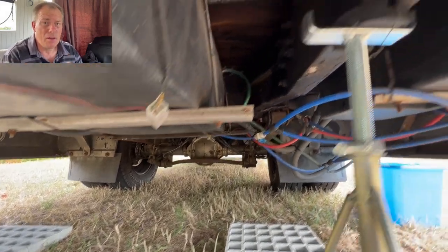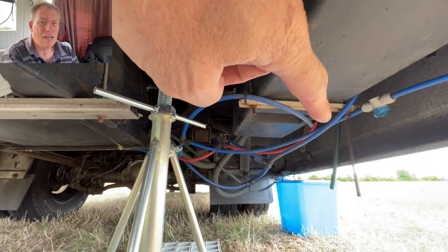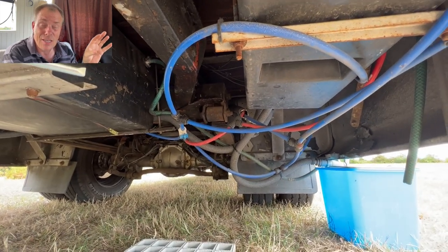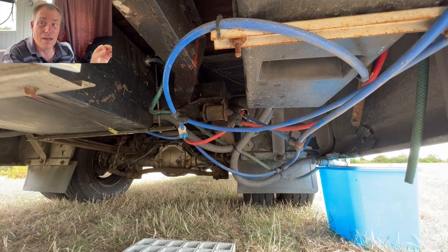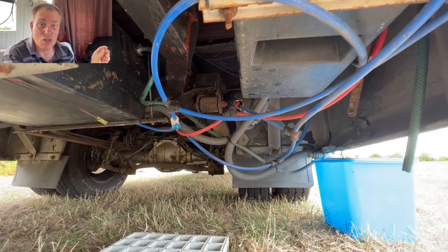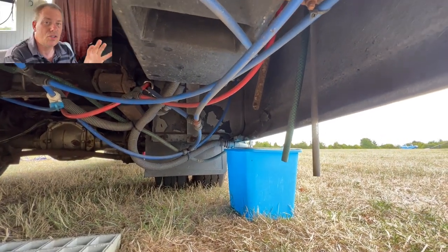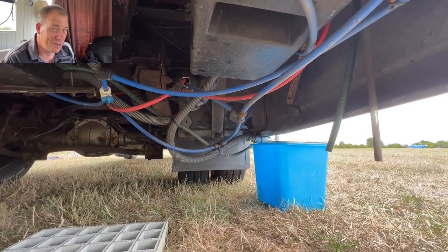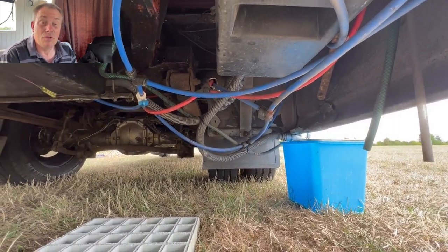The blue and the red pipes were not cable tied down properly. There was also an electrical cable running very closely to the exhaust and to the steering column — that was a rewire job from the campervan builder to the horn, because the centre boss in the steering wheel had disassembled and was completely loose and falling out. That was an MOT fail.